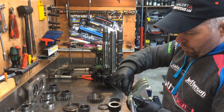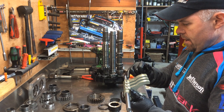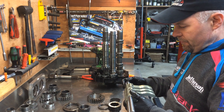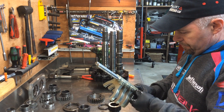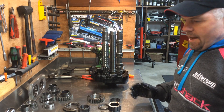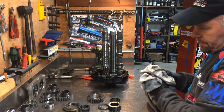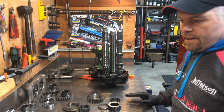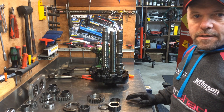The selector pins are always worth checking — these little bullet-shaped selector pins can wear. I've had one wear before, never had one since, but they're under serious stress. They're the ones that run on the journals to pull the gears in and out, so through a stage they'll be moved thousands of times back and forth. Even when you're not using a particular gear or selector, they're still running in a journal, so it's always worth checking for any flat edges on them. These are all good. I'm pleasantly surprised — I was expecting to see more damage, but it's just second gear, and I'm really happy with that. I'm going to clean everything off, order up the second gear, and if it's in stock we'll be back tomorrow to put it all back together again.